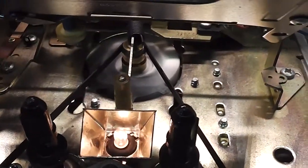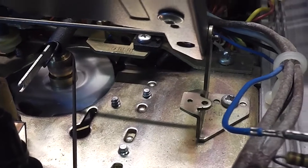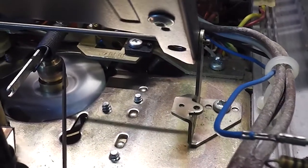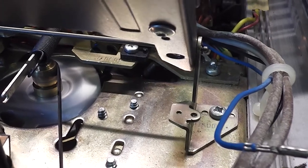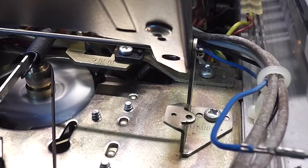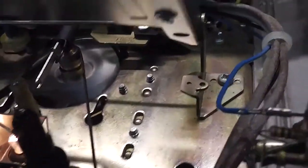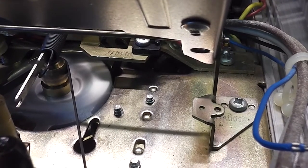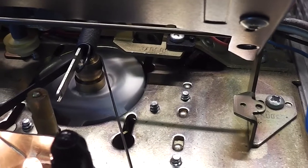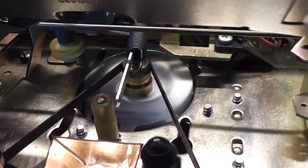Here are the flywheels with the new belt, but just a little point: the belt I took off was 5mm, this one is 4mm. I think it's sitting on the synchronous motor pulley a little bit differently now. The pulley is bigger in the middle and smaller at the outside, so the belt follows that profile. If it doesn't sit in the right place, I imagine the speed will be wrong. It's not something I can correct being a synchronous motor, so we'll have to see if the speed is correct.